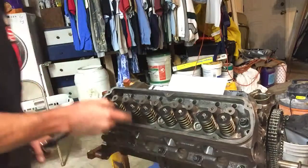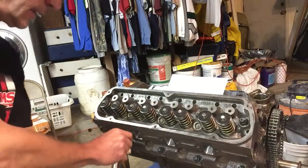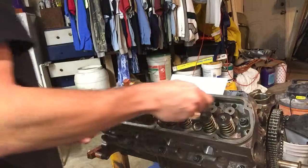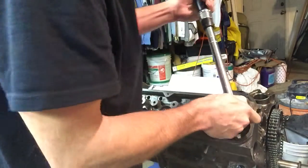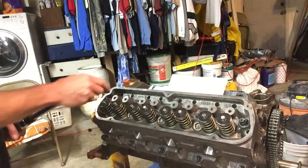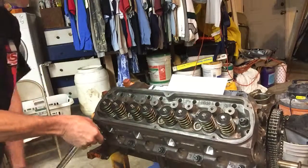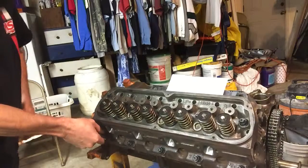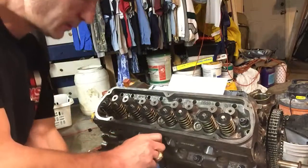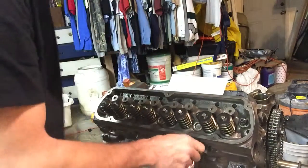One of the reasons we're wanting to do this is I want to get these heads on, particularly one of them at least. I want to confirm my push rod sizing. In order to do that, you get the heads on. And yeah, it's not too bad of a process putting the heads on. Fairly simple. Just a little different for me this time because it's using this ARP head stud kit. Okay, so we've got them all. I'm going to walk around them again, make sure they're all at 27 foot-pounds. It helps me memorize the pattern, which I will know well by the time I'm done.